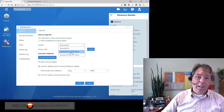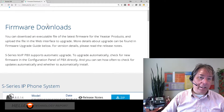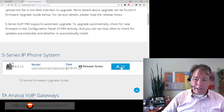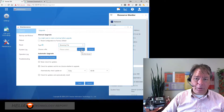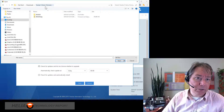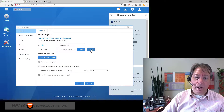Yeastar does require a bin file. You get the file from the Yeastar website. If we go to yeastar.com for more downloads, you can see here 30.8.0.14 — you download the file there. However, that's a zip file, and so you do need to unzip it before you upload it from TFTP, HTTP, or local. I've downloaded a different version already. I'm going to go to browse and find this version — I've got 30.8.0.8 — and we're simply going to upload.